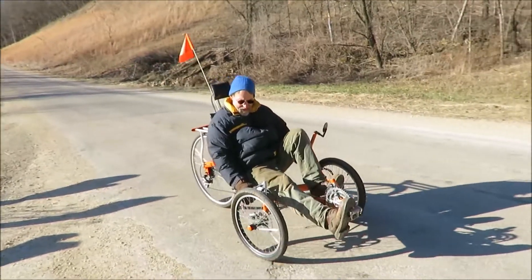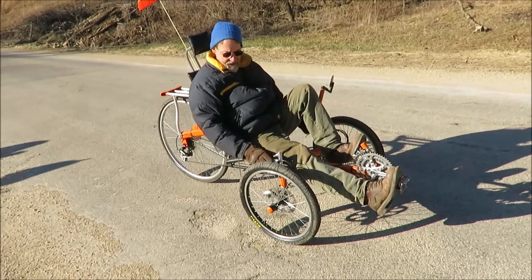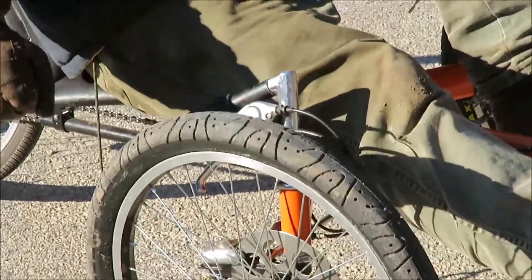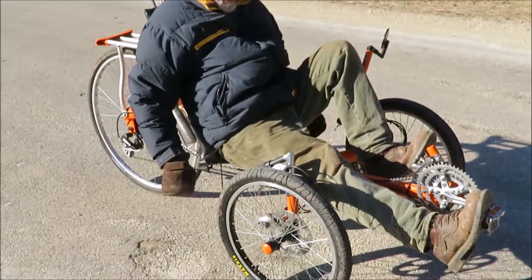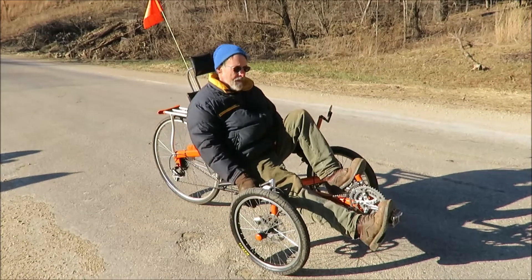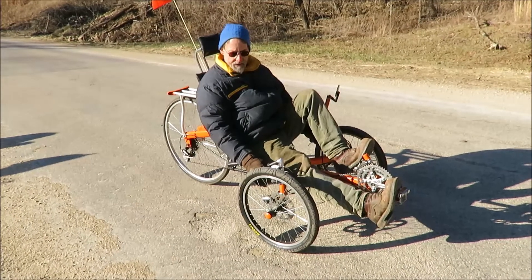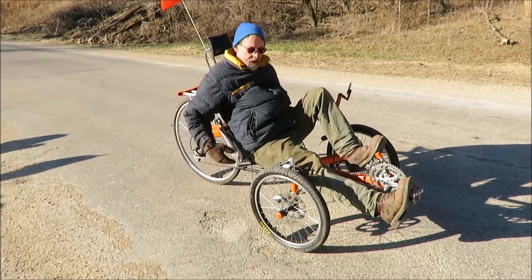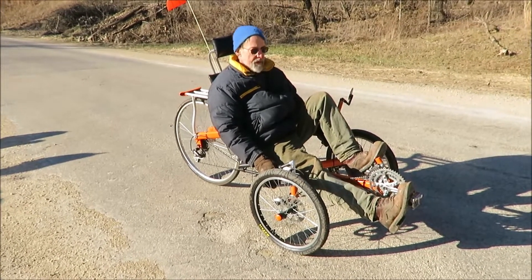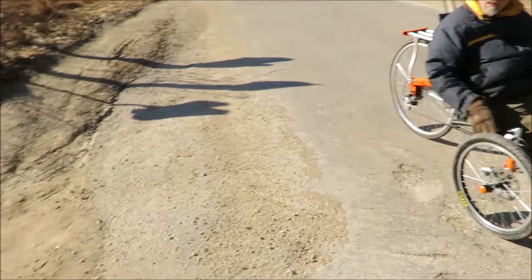So at this point the big changes: I need to come up with a different kind of rubber that'll grip the front brakes better, and the steering is too sensitive — I've got these real short steering arms for these big wheels. I either need to go out like this so I've got more leverage on them, or else go with under-the-seat steering. Otherwise everything else works good. I'm stuck with that rear traction problem — there's nothing I can do about that unless I wanted to add weight. One option when I do day trips is to carry a cooler or little equipment on the back just to give a little more weight. But if I'm going up a hill like this driveway, I can't pedal up it because it spins out — I'm lacking traction.